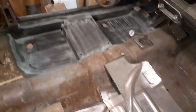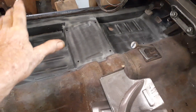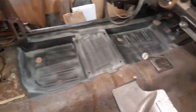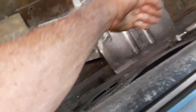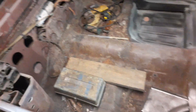Let me show you the Mustang over here — this is what's taking a little bit of my time. I put floors in this. All this was gone, that whole assembly there. The inner rocker was completely gone, just nothing there. So I had to fabricate all that because I didn't want to take the center out. Underneath the center is okay, so I just left the center and attached the floors to everything, then went underneath and welded everything. The floor looks like a floor now — it was really gone. Then I've got to come over here and do this side. This is the good side, but you can see it's still got holes all through it, and the sill is gone. Then I've got to do back beyond the seats — they need to be replaced. There are my new panels and some more.